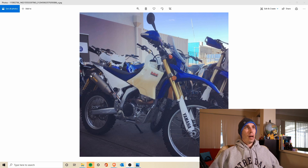One thing I'm not too fussed about is the FMF pipe. I know a lot of you guys like this and talk about your gains in power, but I'm not really after peak horsepower gains in a dual sport — I'm much more interested in increasing mid-range torque and reliability of the motor. I'm not convinced this does anything really, but that's another discussion. I would much prefer the stock extractors with a GYTR muffler so I can have the stock heat guards down near the legs to stop my bags from melting. But it is what it is — I'll take it and probably get one of those Giant Loop exhaust protectors somewhere along the line.